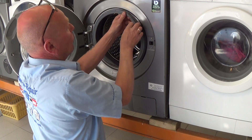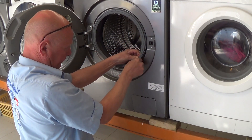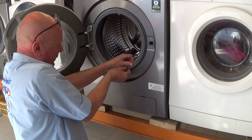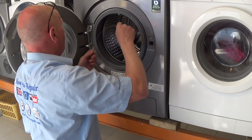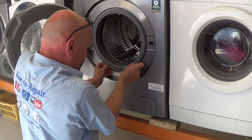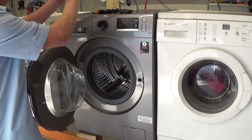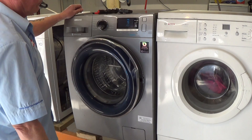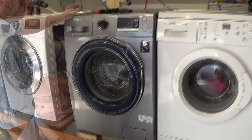Watch your fingers on these sharp edges. Carefully go around putting the seal back on. Then put the wire band on, lining up the spring where it came off before — stretch the spring slightly. They're quite easy on these Samsungs. Then plug the machine back into the power supply, shut the door and press the start button.